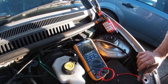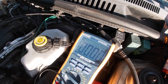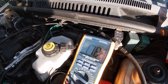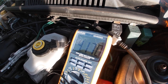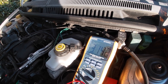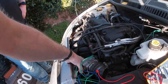We've got no voltage whatsoever at the moment, which is good. Dave's going to go and turn the ignition on again. We get a slightly different reading to start with, and as I turn it, it goes up all the way — nice and smooth. So that's working. It reads a slightly lower value than the old one, which is good — the other one was slightly off. Let's reassemble it.